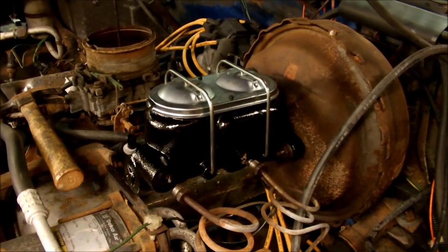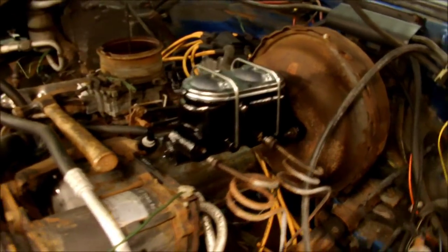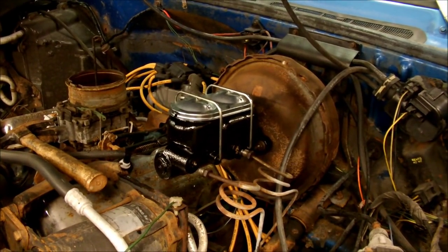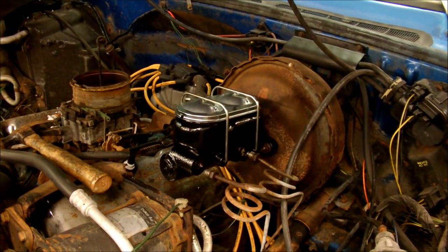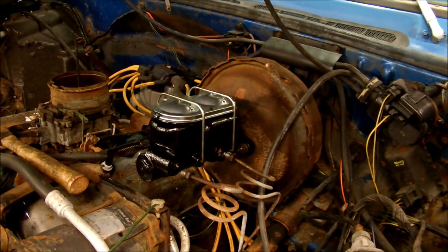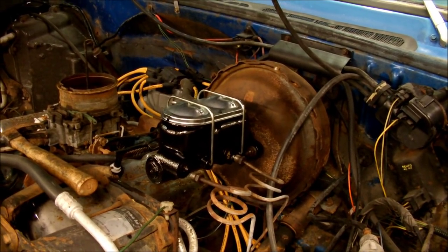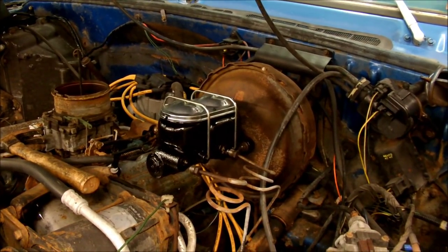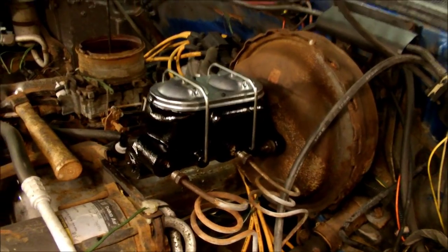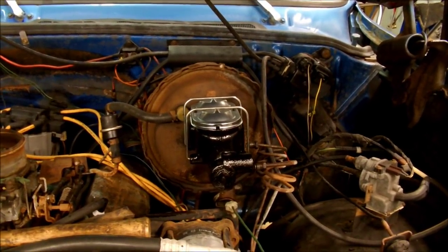Then you reattach the lines. Now I'm not going to reattach the lines because I pointed out that one flare is screwed up. But after you would reattach your lines — assuming you don't have a freak show line like I do — then you go through and bleed the brakes. The order you bleed brakes on most vehicles like this one is passenger rear to driver rear, passenger front to driver front. You pump fluid, you have someone in the interior push the pedal down, you crack the bleeder screw in the back, let the fluid come out, close the bleeder, they let the pedal up. You repeat that procedure until you get no air out of each wheel, going farthest wheel to closest wheel, and that'll get all the air out of your system. But I can't do that now because my flare line is screwed up. There you go — it's pretty simple, a master cylinder change. Hardest part is bleeding it, which I didn't even cover in this video. But at least you can see I'm making some progress on the truck. I'll have more updates soon. Thanks for watching.